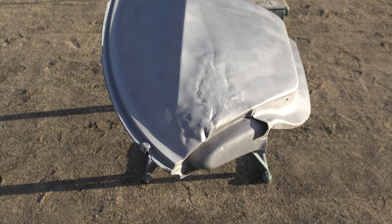And with that done, it's time to install the trim. I first place the stud into the hole, and then align the trim to the best of my abilities. Once in place, I begin pressing the trim down. The trim snaps in place once pressed down, making this installation super simple. With the trim in place, I install the retaining screw at the rear of the fender, and then install the retaining nut on the front of the fender. With the driver's side done, I then repeat this process on the passenger fender.